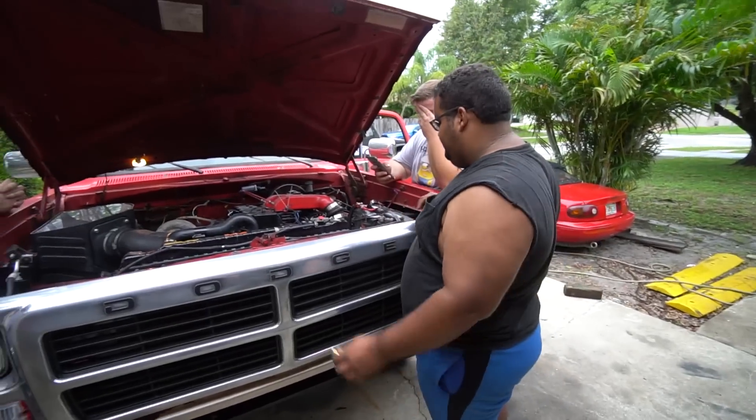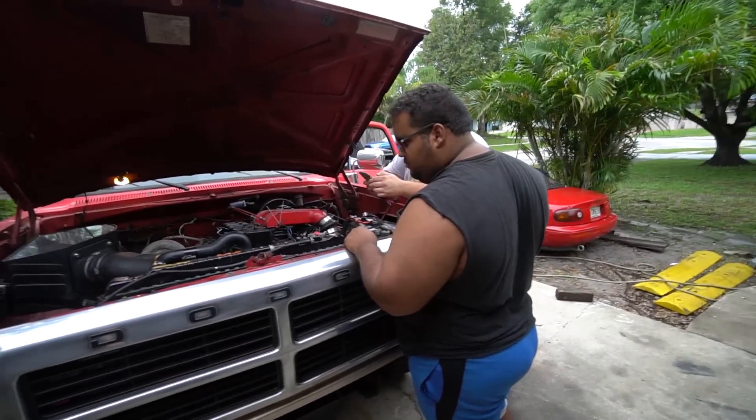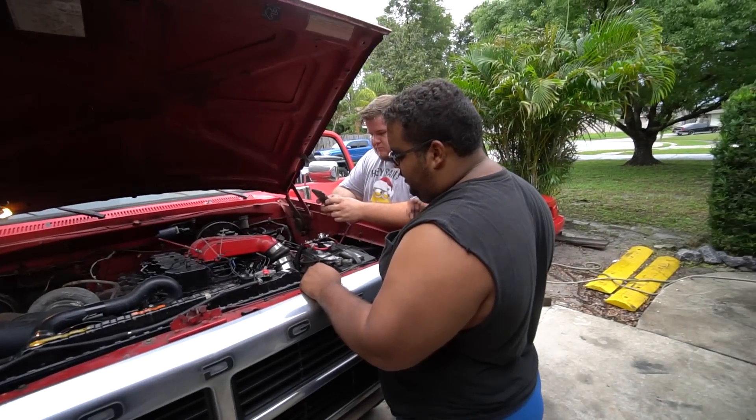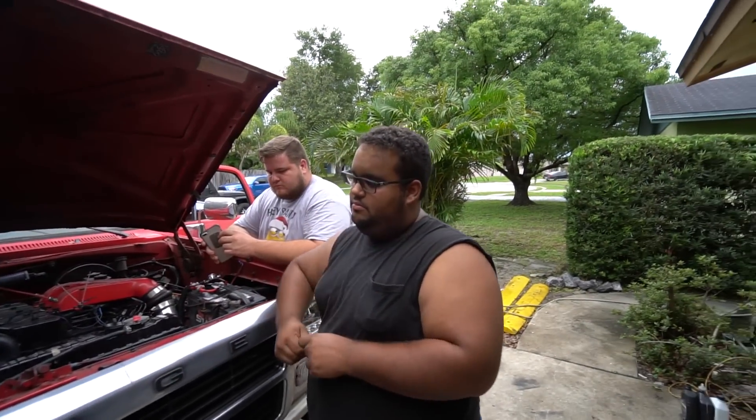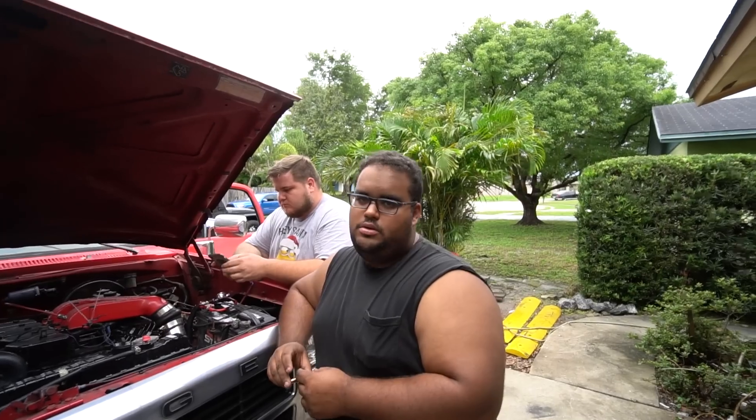The fans are all working. The pins to the probe backed out so I couldn't adjust it right, but I've got it adjusted to a good temp now. I can turn them off and on depending on the dial — everything's working. I should let it warm up from cold and then fine-tune the fan turn-on temperature like that.